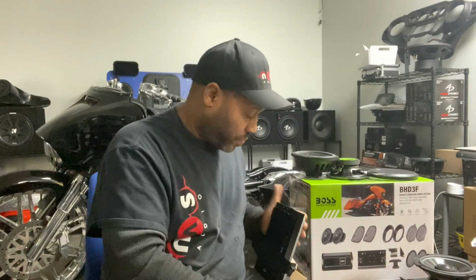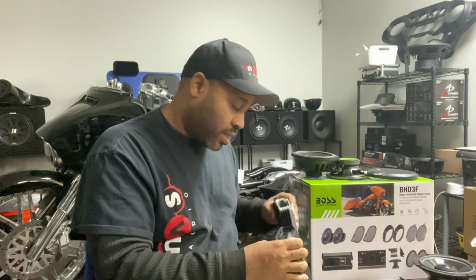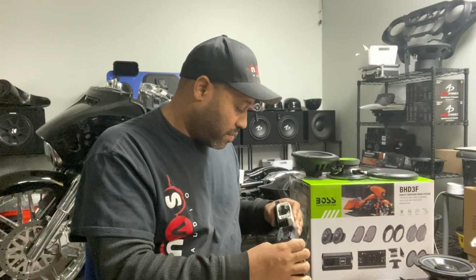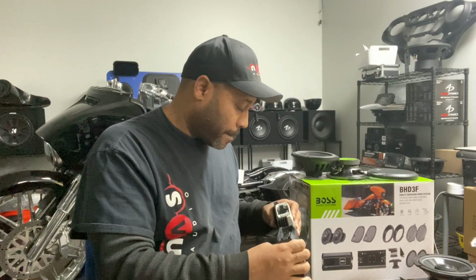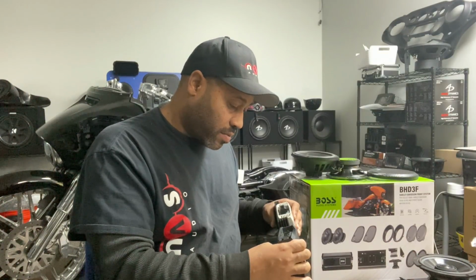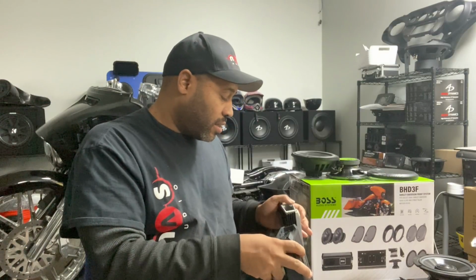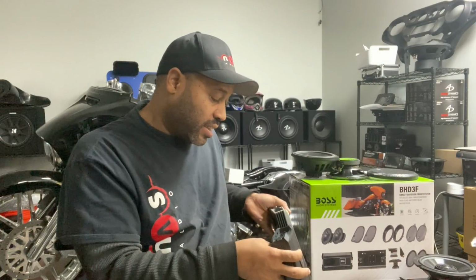Speaker connections. So we have the speaker output side on the same side as power, and I'm looking at the Rockford and I'm looking at the Boss, and they're identical. So we have front on the right, rear on the left. They get bridged the same way, and the speaker orientation is exactly the same on both. RR, LL, RR, LL. So the only thing different on the input side is the arrangement of the power wires. On the speaker output side, they're identical.